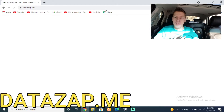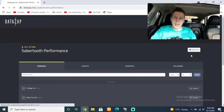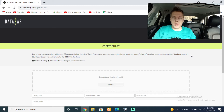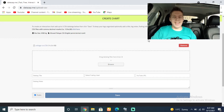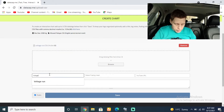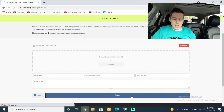This is actually very easy. There's a website you can go to — just put your hotspot on your laptop. Go to Chrome or Google and type in datazap.me — I'll drop that on the screen for you guys. Then quickly log into your account, and if you don't have an account, just go and create a new one. We're going to go here to upload our log, select the English version. If your VCDS was in a different language, you can select international language. We can drag the file in here, or just select it. We'll title it 'voltage run' and keep it set to public. My account name is savertoothperformance — if you can find me, you can come and view all my data logging files. We're going to say save.